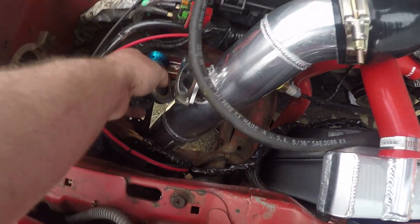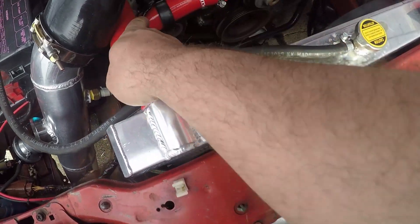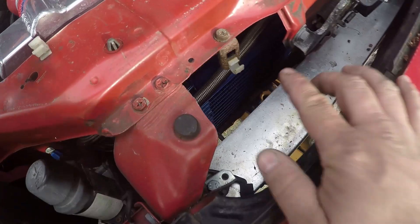I still gotta put my blow-off valve on here. Also added an aluminum radiator, new G-Plus coolant hoses, a squash plate which you can see right down there, and my oil cooler is now mounted up here. I've got the AEM EMS4, which is relatively on the cheaper side of standalone EMS units but it's made for a four-cylinder. It has tons of GPIOs — general purpose input/outputs — one is for my fuel pump and one is hooked up to my cooling fan.